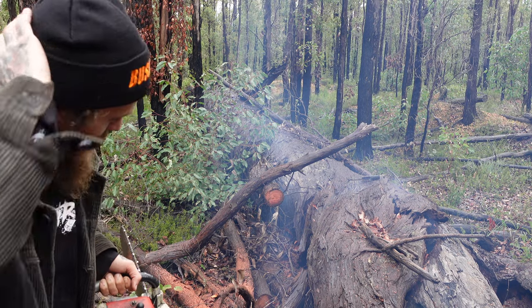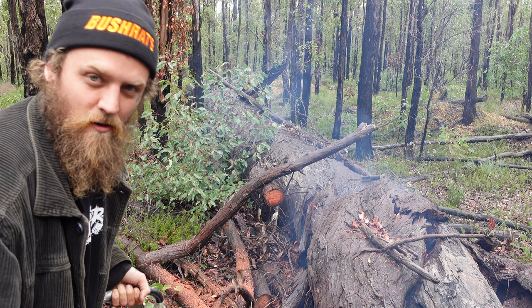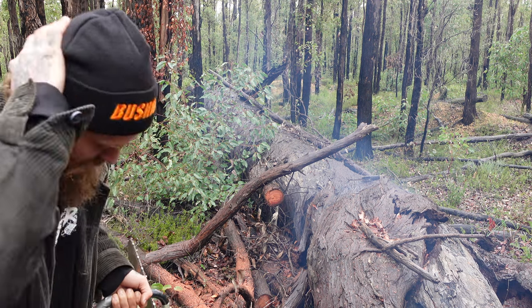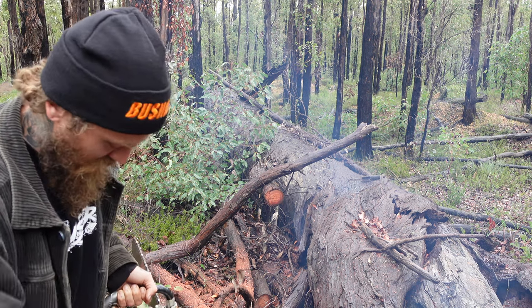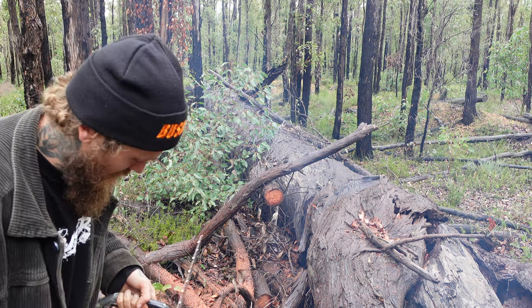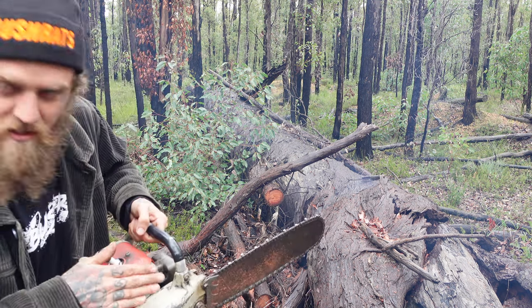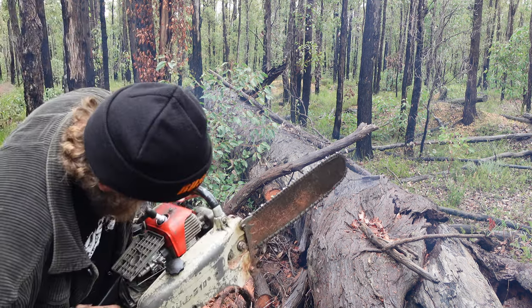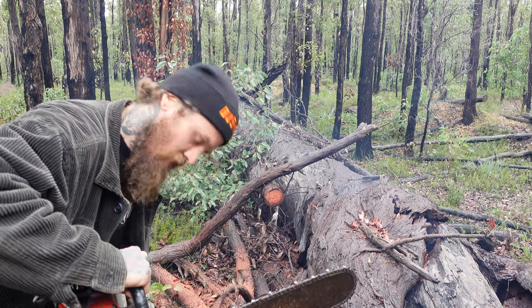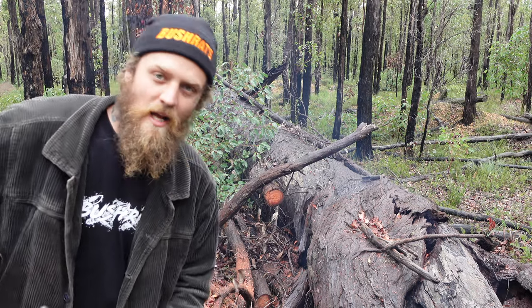Smoking hard. There might be the stale fuel, maybe too much oil in the mix. She conks out, so she might be too much fuel or not the right air mix with the filter off. But like I said, we can fine tune all that, but here we go, guys. It's pretty hot as well, but stoked, $160. Keep your eye on Gumtree and eBay as well.